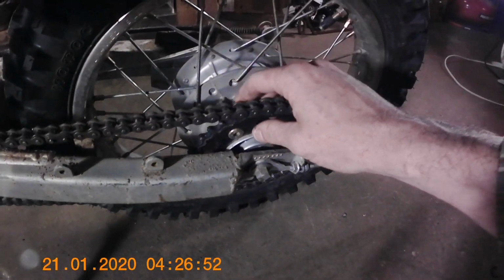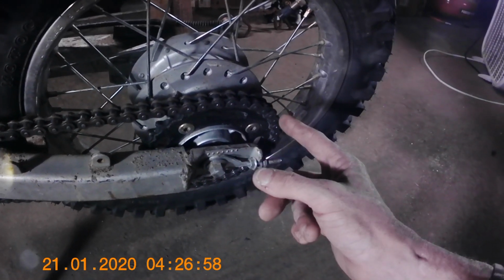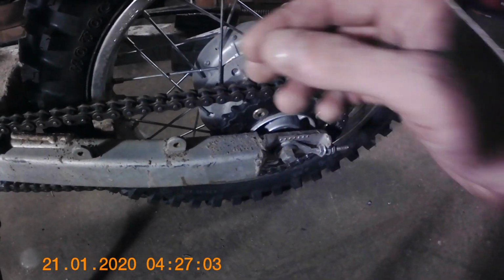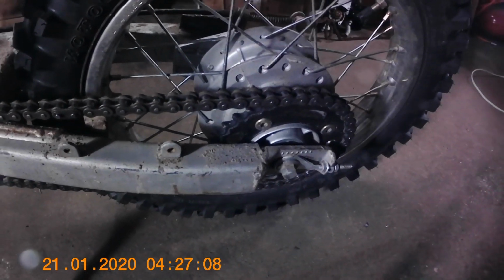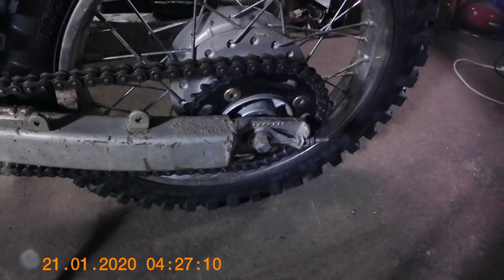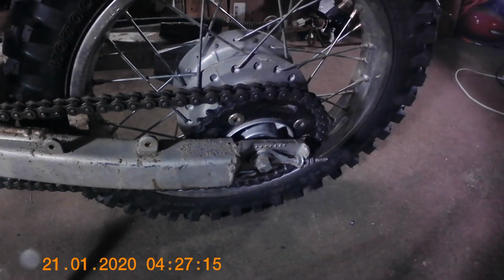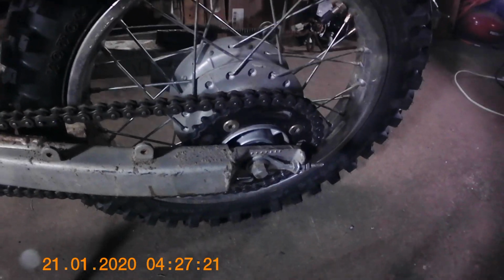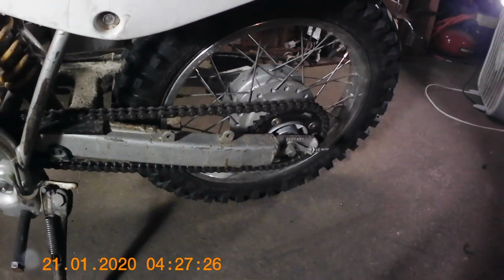And yeah, the rear sprocket I put on, I changed it. Originally it had a 46 tooth. This is a 36 tooth. It was the only one readily available, and I kind of knew the gear ratio was going to be a little too high. And I just decided I was going to send it anyway. So I think I'm going to change that. I got a 38 tooth that came in the mail, and I think that'll be better. I probably should still put the 46 back on, but I want it to go faster than my buddy's mini bikes, and I need a little more gear. So, yep, that's kind of where I'm at.